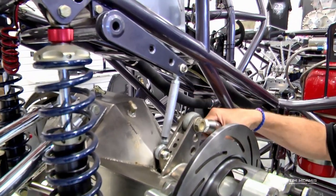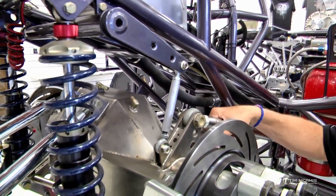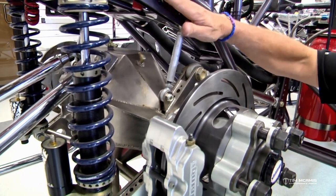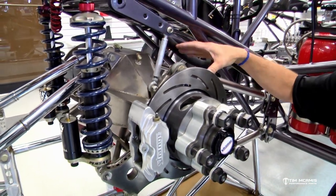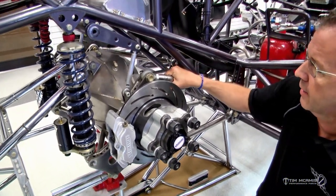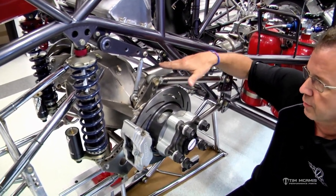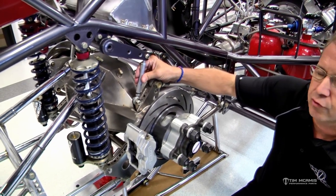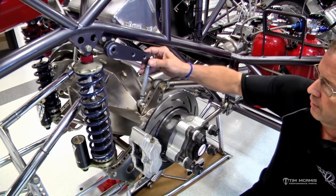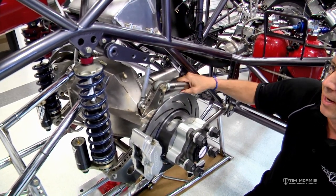If I put a half flat of negative in and the car still goes left, I come back to neutral and put one full flat in. The anti-roll bar works the same way — if I have a half flat and want to add another half flat for one whole flat of negative, that's going to twist the rear end housing and load the tires differently. So I want to re-neutral the anti-roll bar. Preload first — jammed up — then set the anti-roll bar to neutral, set the car down, and you're ready to go.